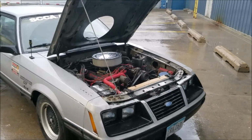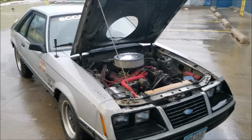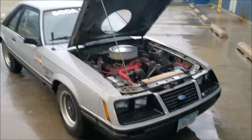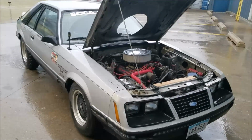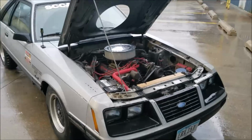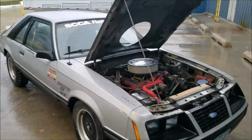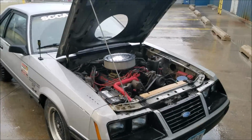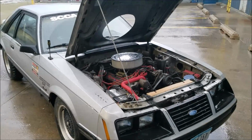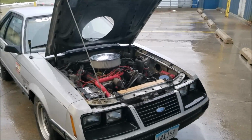Some other things to consider: because of how thick it is, your oil pump drive shaft, when that oil is cold, it can literally shear, and then you're going to have no oil pressure and destroy your engine in a hurry. Especially on these Fords, they use a smaller oil pump drive shaft than the Chevrolet, regrettably, so you have an even more increased chance of this. And I fully believe if I had good bearing clearances in this engine, I probably would have done so. It's probably because it's so worn out, it saved me there.